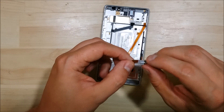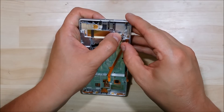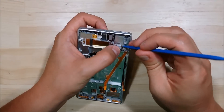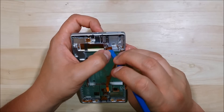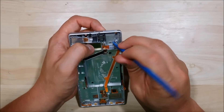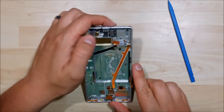Next item is the vibration module. I put the silicone cover back on, and it has a little bit of a Y down at the bottom, so you can go ahead and push it back into the back side of the device. The little silicone cover will need to go on the inside of the little slide slot that it fits into. Just make sure you take your time to make sure that the silicone cover guides back into place properly. Use a pry tool to press down a little bit, get some pressure on the remaining adhesive, and put it back into place.